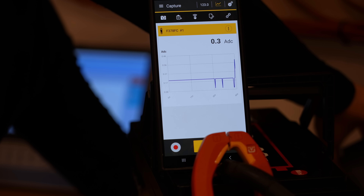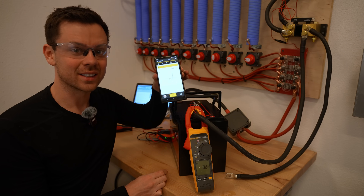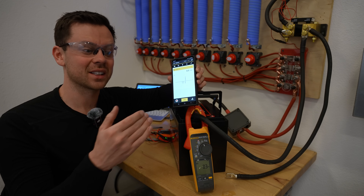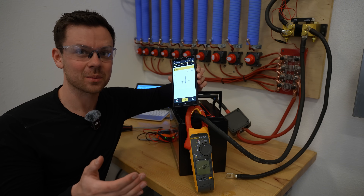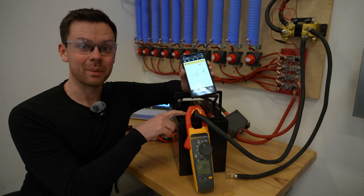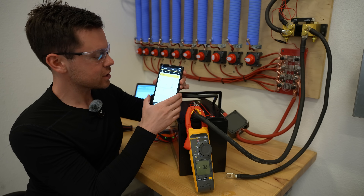Turn it on. Oh it caught it — that was fast. And that's exactly what we want to see. A lot of the budget batteries do not have overcurrent protection and they can output 600, 700, 800 amps. Now even though it passed this test, I recommend everyone still add a fuse to these batteries, especially the cheap ones.